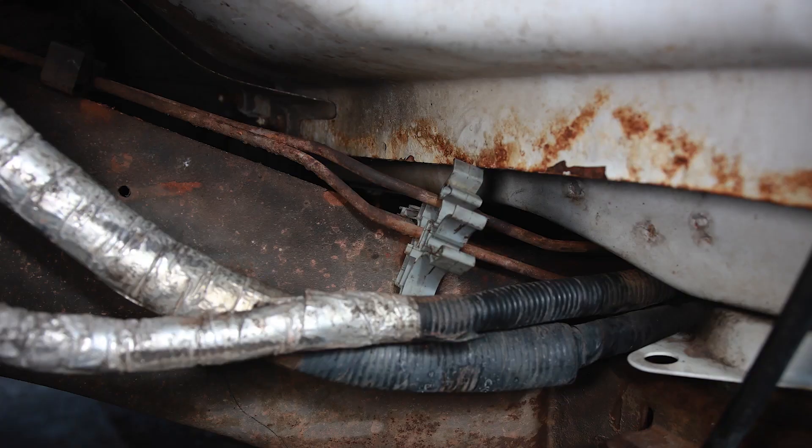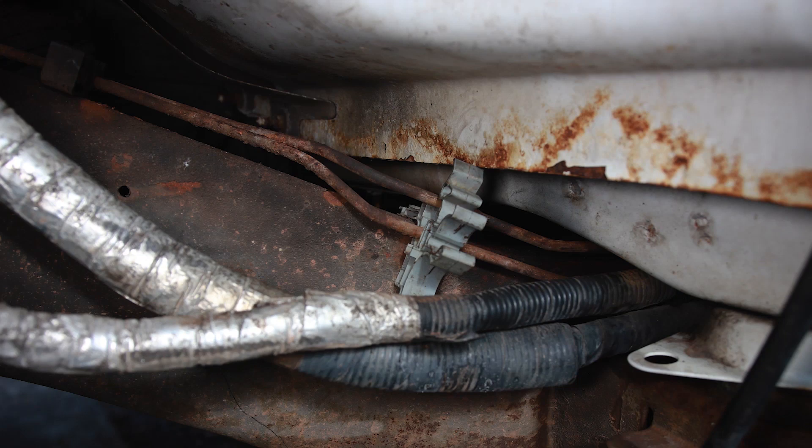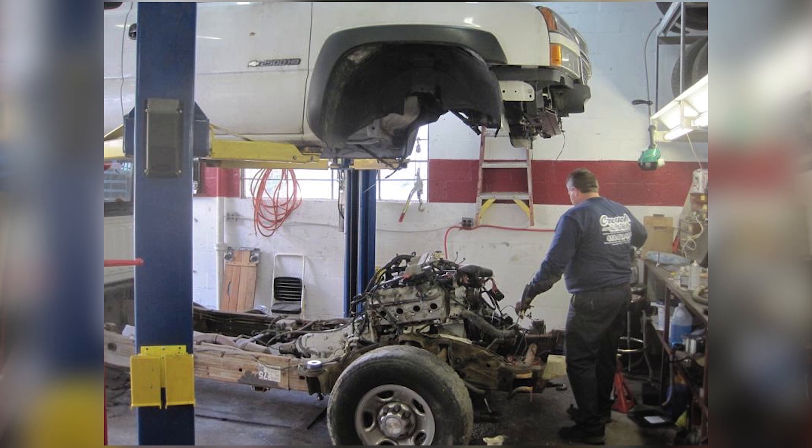The inconvenience is sometimes it's not that easy. In the case of my Silverado, the brake line runs between the frame and the cab and I would literally have to remove or lift the cab to get to some spots if I was using pre-bent brake line. Also, brake line on many vehicles may run over the gas tank in the rear, so you'll have to drop the gas tank in some situations. With a roll like this, you can fish it through where you need to go and bend it as you need.